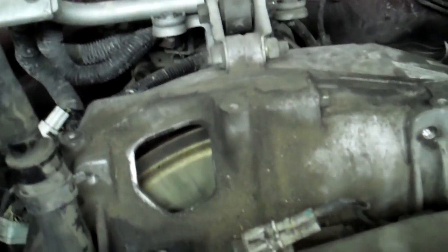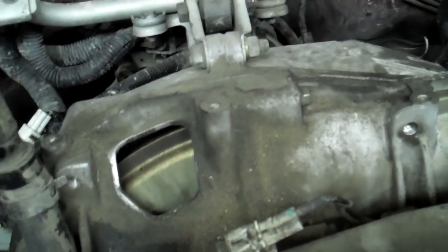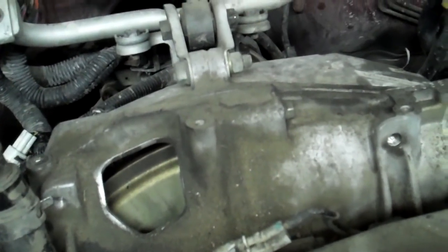If you pull the torque converter, it'll be murder getting it to line up again, and you risk damaging the front pump on the automatic transaxle. So that's where we're at. Let's do the bottom. Wow, I've already gone 10 minutes 40 seconds. This thing's going fast. It's kind of crazy, huh?